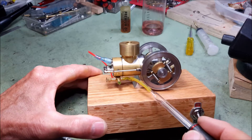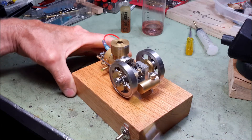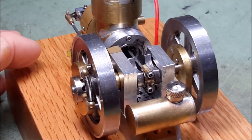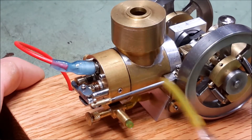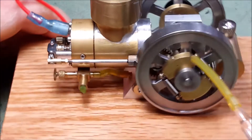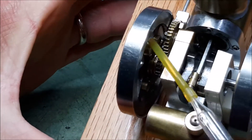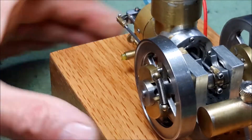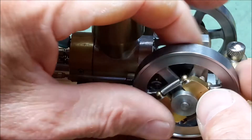This little mixing device on the bottom right here has a needle valve for controlling the fuel. The fuel tank is on the back. The exhaust valve does have a rocker arm and connecting rod, and there's a little mechanism in here that holds the exhaust valve open when the engine reaches a high enough speed for these weights to spin out.